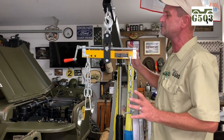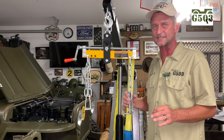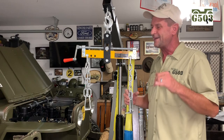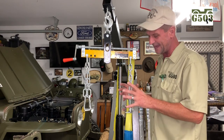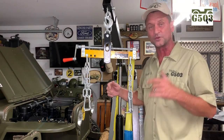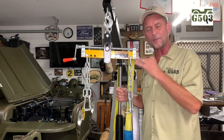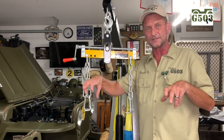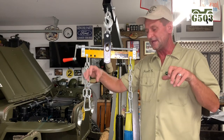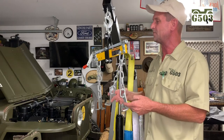In this video I asked a bunch of guys — professional mechanics I've known, old school guys and Jeep guys — and there was a big debate about where to attach either your strap or your chain to the engine to attach to the hoist to lift it. I use the outside four head studs or head bolts on the engine and I fasten it with these hooks as per manufacturer's instructions.